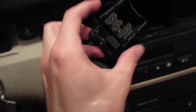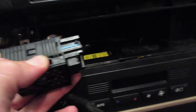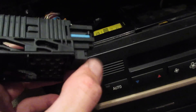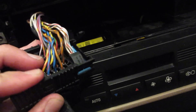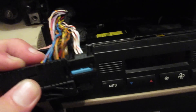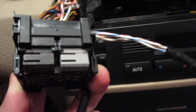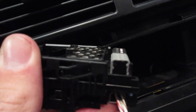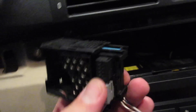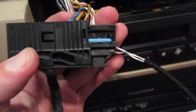In order to do that, you're going to see there's not a lot of wire to work with here. With that part slid all the way out of the way, we've got this little blue thing right there. We need to pry that out — that's going to release the accessory ports to the back of the radio. We're going to drop the new gray connector in right there and slide the blue thing back, noting that these things need to come down so they're flush with the big main radio round connectors. If you try to make these flush with the black plastic, it won't work. We'll slide the blue thing back in place.